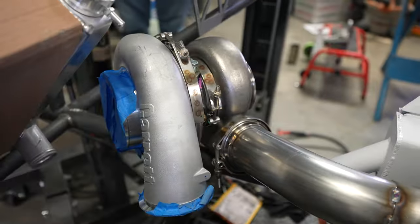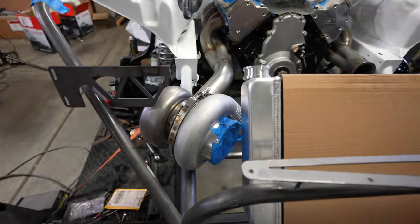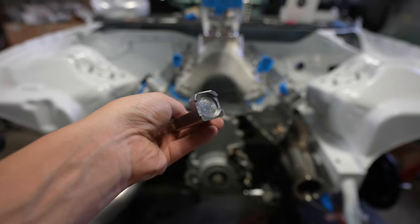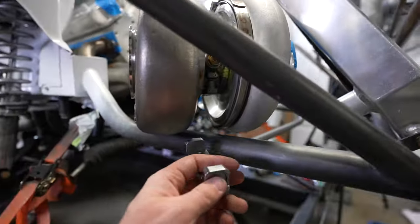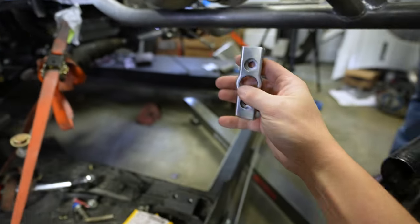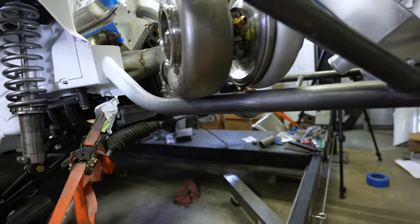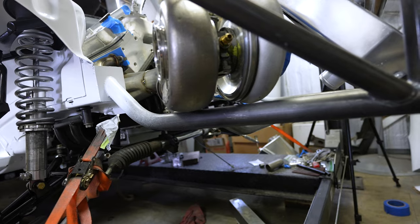Those are some tacked welds — it's hanging on its own by the V-band, which is actually pretty stiff and rigid. I did order some Maven mounts — these go to the bottom of the turbo. They're super nice: all billet, you can weld the tube into the end, they bolt to the bottom of the turbo with a little O-ring. My idea is to have the turbo mount sit up on the flange and have a mount come off it. The drain off the bottom is what I need to be careful of — I need to get a 90 out so the oil drain can head in the right direction. I think we're going to be okay and the oil drain won't hang lower than the turbo.